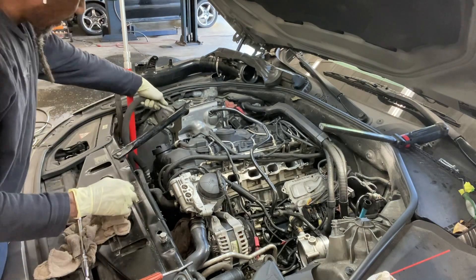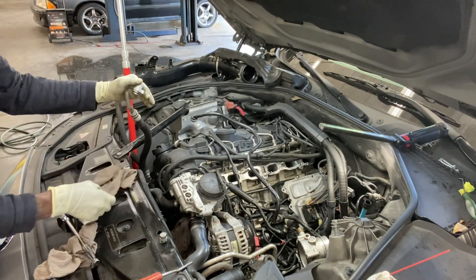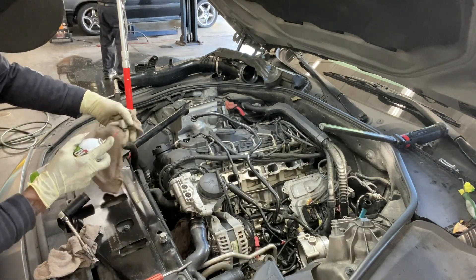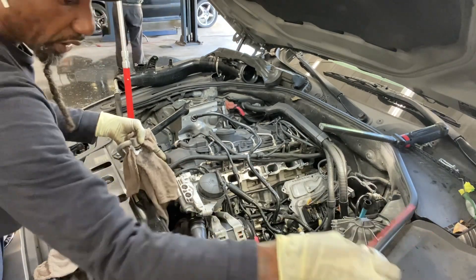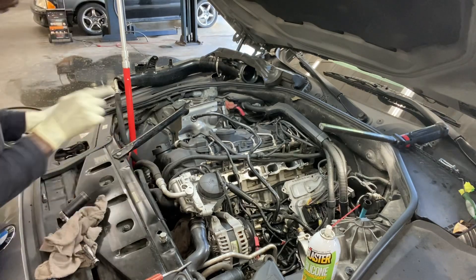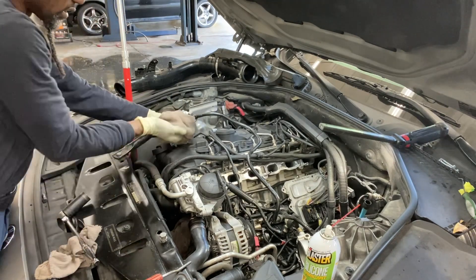All right, let's get our lines in. You're going to want to spray some lube around these O-rings, just for the simple fact that they're O-rings. I'm not going to replace them because they weren't leaking. Sometimes you say you're going to replace them, you take them off and you can't find the right size back. So if they weren't leaking, put them back. Spray a little lube around them to make sure that it doesn't get caught.